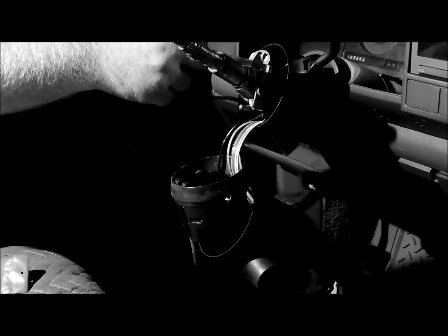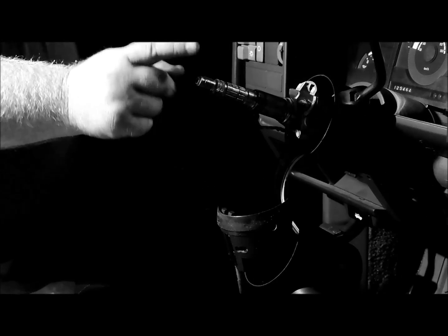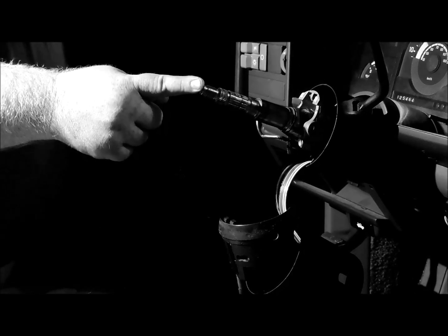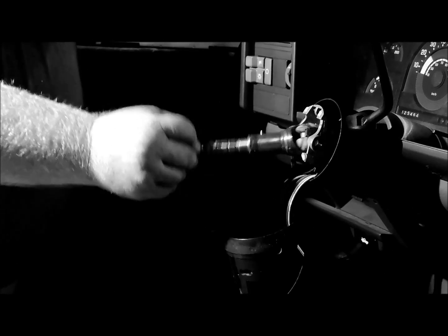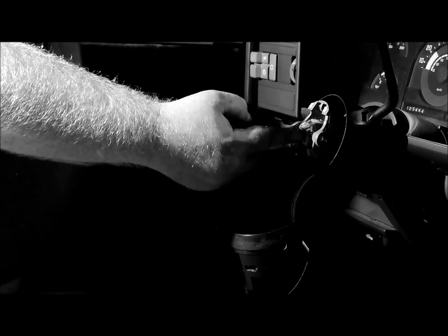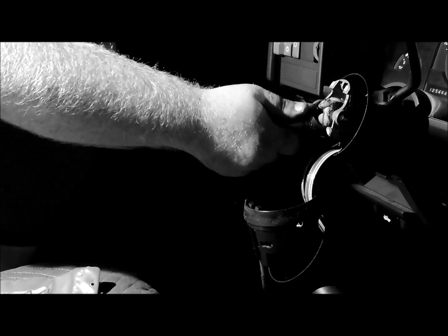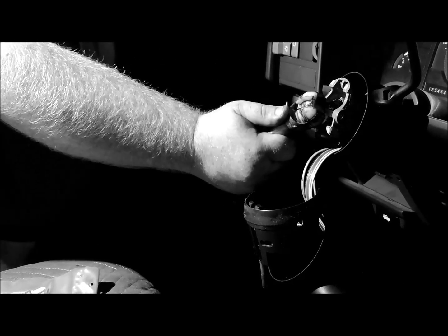And now down in here, this is the hub that those 2 pivot pins go into, and there's 4 bolts in here, and that's where the bolts get loose. And we got to remove the upper portion of the steering shaft. And this little plastic coupler here is what allows the wheel to tilt. This is where it all goes on here. And all you got to do is just rotate this around and slip that out.